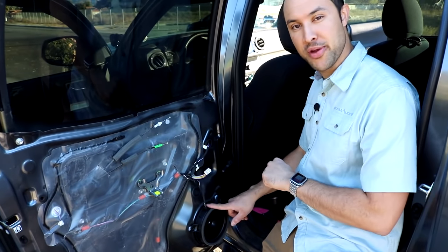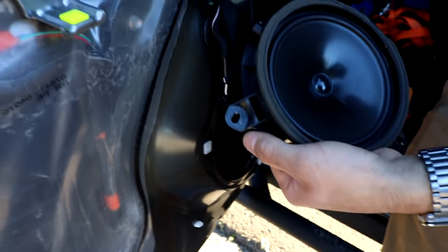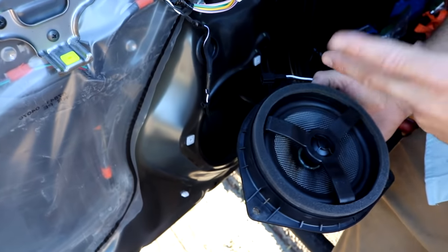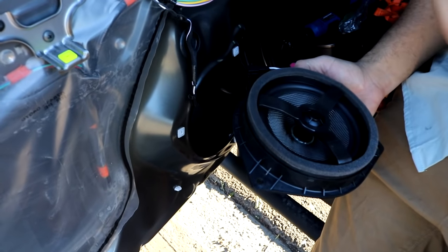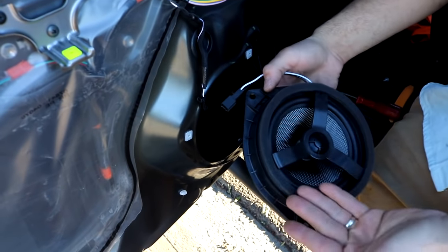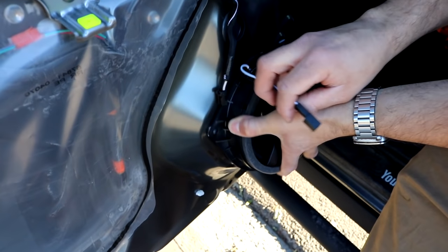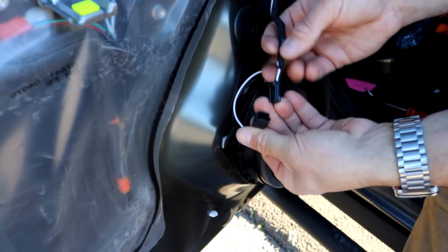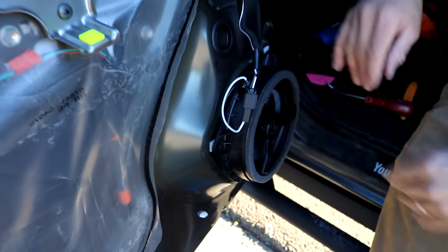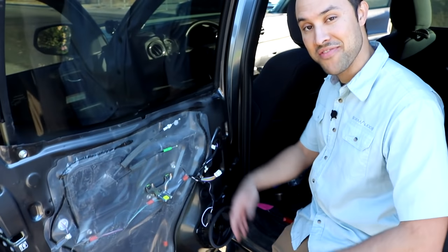Toyota did change the rear speaker connector on the 2020, but however, the OEM Audio Plus system did take this into account. So if it's a brand new order, it does ship with the adapter already in place. In this case, Jesse had his speakers from his 2018 that he pulled out of his Reference 500 sound solution before trading in his vehicle. And so we've added the adapter to his existing speaker. So again, we're able to work with the existing infrastructure of his previous system. But nonetheless, we are providing an adapter for a plug-and-play installation, ensuring that there's no compromise in terms of connectivity, no cutting, no splicing, anything like that. We're able to interface with the factory wiring without any fanfare.